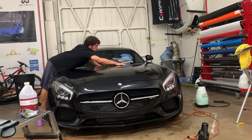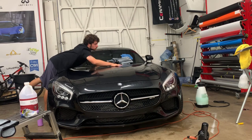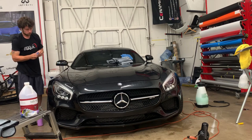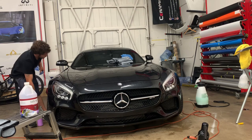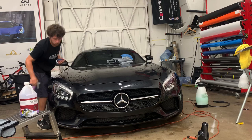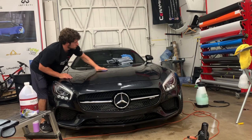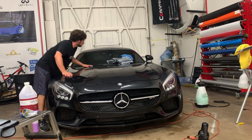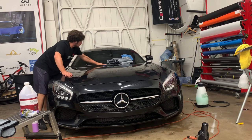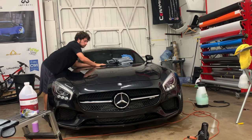Sometimes on cars with a big wide hood like this it's hard to reach certain places — that's okay, a lot of us struggle with that. Generally if you're polishing the car afterwards, it's okay if your pant leg touches the fender; just always make sure you're wearing gym shorts or soft clothing so if that does happen it's fine. See now I've done that section — I'm folding it up again to get a nice clean surface and spraying some more Shine Mist. The center of the hood felt kind of bad so I'm going at it again. Generally the places that build contamination the fastest are the hood, the trunk, the roof — all the top panels most exposed. A roof will typically have more contamination than any other part of the car; you might spend a few minutes on a roof where you'd spend just a minute on a door.